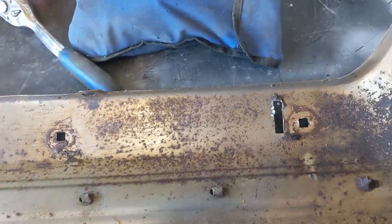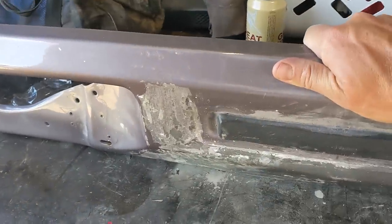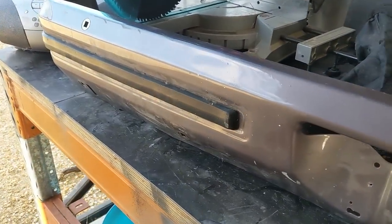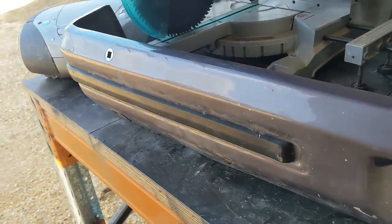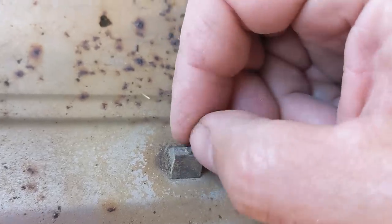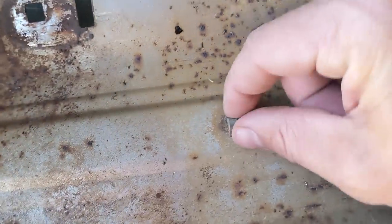Before I get to that, I want to strip this paint. It comes with a purple paint from a custom color, and someone's already attempted to remove it to reveal the chrome underneath - they achieved a little bit over here, not so much elsewhere. I'm going to use paint stripper that doesn't react with the chrome. First I need to get rid of these rubber strips by removing the little arrowhead clips through the holes in the back of the bumper, plus a little nut - both are going to be difficult because the nut is pretty rusted and the clips have hardened over time.